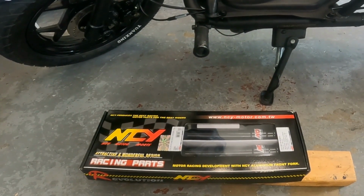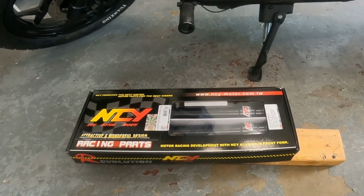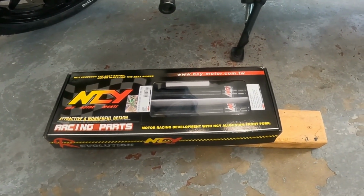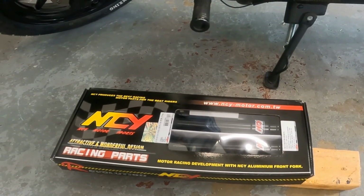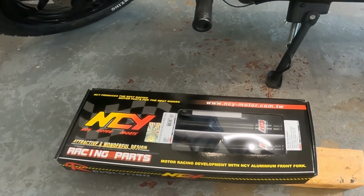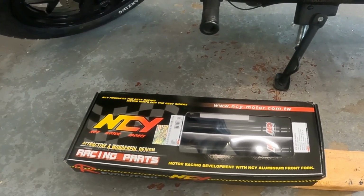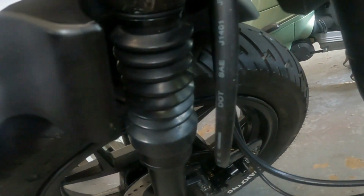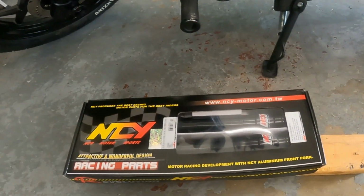All right, so the part one video is to try to figure out if we're going to use these things or if you want to use them. Go over the pros. The pros are, they're a better quality fork. I did mic the steel uppers, the stanchions, and they're thicker. Even though they're 27 millimeters versus 31 millimeters, they don't look as cool. But if you keep these like 1980s dirt bike fork looking plastic cover things on there, then you're not going to notice that they're littler and spindlier.